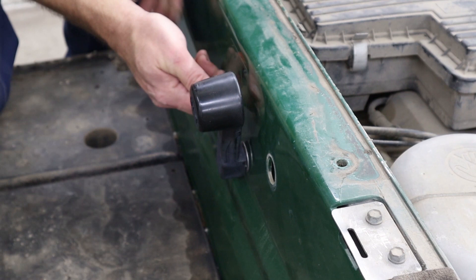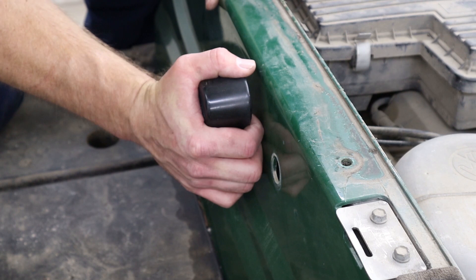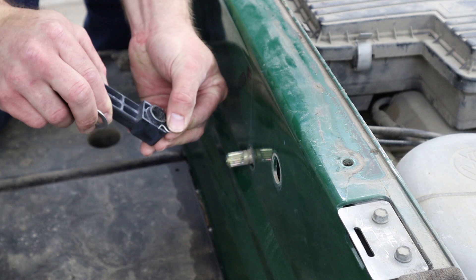To remove the forward and reverse lever, you need to use a flat head screwdriver to push down on the C-clip located on the backside of the forward reverse lever. Be ready to catch this clip as they do like to go flying. Then you can pull forward on the lever, rocking it back and forth to disengage it from the shaft.